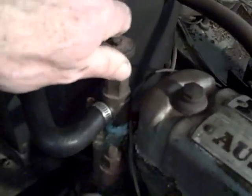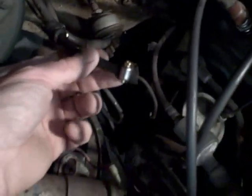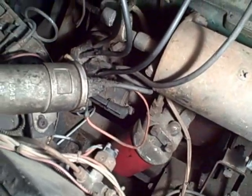I've changed this heater hose - the heater valve is how you turn the heat on on a Bug-Eye, right here. Also very important: make sure you change this little hose that feeds the oil pressure gauge. It's not so silly when it ruptures because you will drain the oil out of your Bug-Eye engine and risk doing serious damage. It was corroded and before I restarted the car I did change that. I also changed the oil and here's that filter down here - those are the old-style cartridge filters and I put a new one in. The car did start and run, and with a few more items addressed I'm sure it will be a good running car. There was good oil pressure when I started it.